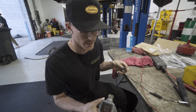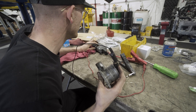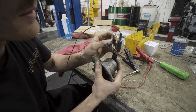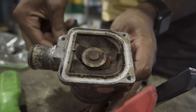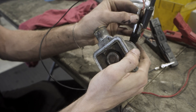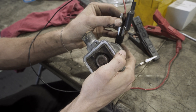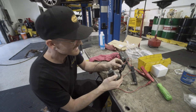To bench test it: you've got your ground, and I've got my handy dandy jump pack. Just as the ECU would, if you supply power to the other side you'll see it open — and that is quite literally all it does. When it's open, it allows fresh air to pass through at a pressure that overcomes the exhaust back pressure and infiltrates the exhaust system.